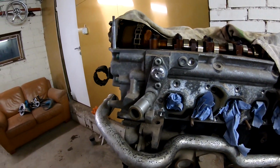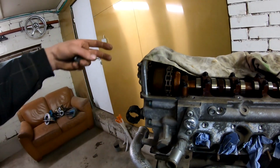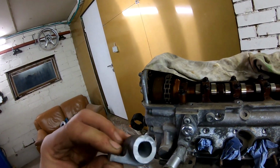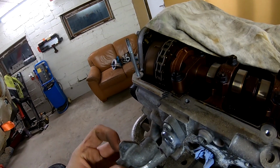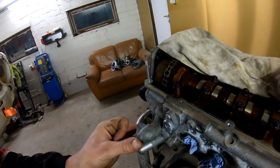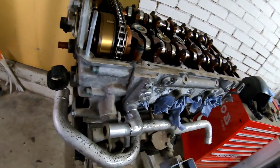I installed it back to the engine. So the other idea I have is that this coolant pipe goes to the interior radiator, but it is located somewhere here. So if I want to use this, the rubber hose comes something like this, but I have an idea to use this nice corner. I marked the place where I am going to cut and put this corner, and here I weld this connection place, and then I don't need such a big corner here with the hose, and I can go here to the interior radiator. So bolt it on the engine, and all looks nice.